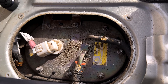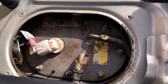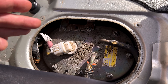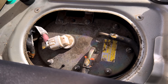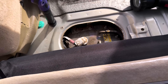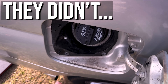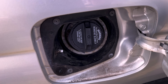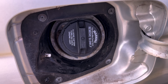That's where we're at now — waiting for Subaru to send me that gasket. We're going to replace that gasket and that should be our EVAP issue solved. What I think happened is that the car sat for so long that the fuel pump died. They replaced the fuel pump but neglected to replace the gasket. Shortly after, they had an EVAP code come up — the same one we had — and they said, 'We must have a bad fuel cap,' so they replaced the Subaru fuel cap with this aftermarket Stant fuel cap. That's probably not too long before the customer purchased this car and brought it to me — at least that's what I'm hoping based on the evidence I've seen so far.